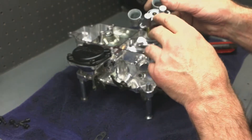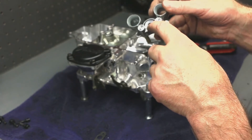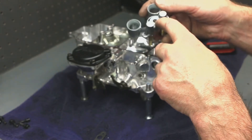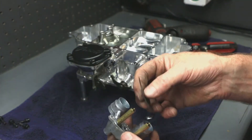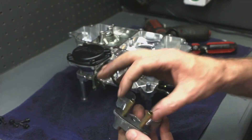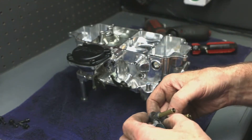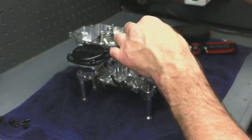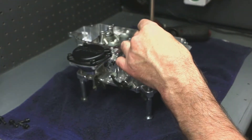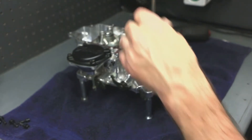So from the top of the booster cluster you can get to the idle jets. Holleys don't have those unless you spend a lot of money, so those are adjustable. You can buy those jets almost anywhere as a Holley part. I wanted to change the main jets first and then go drive it and see what it does off idle.